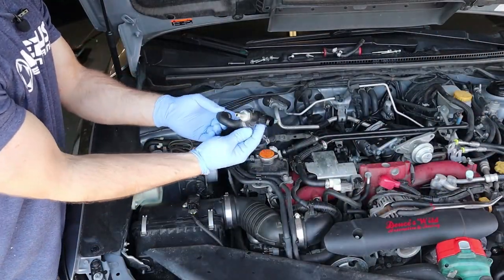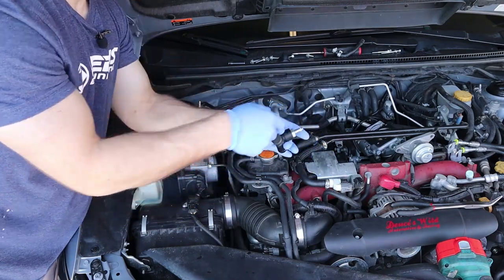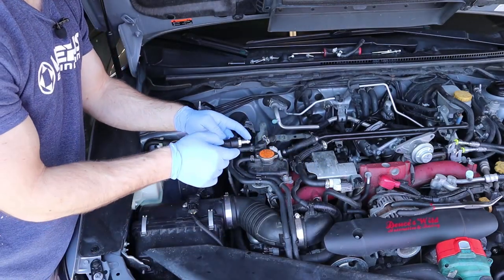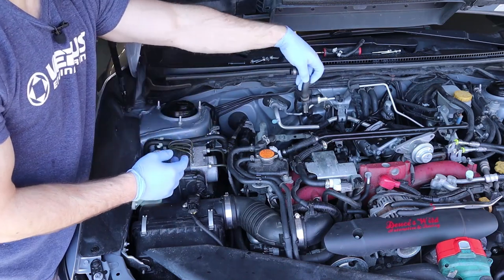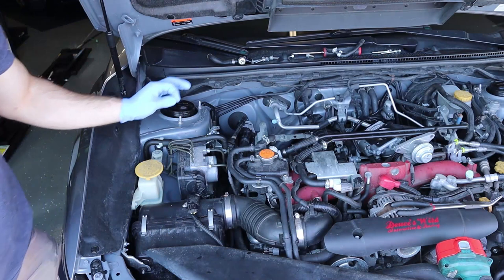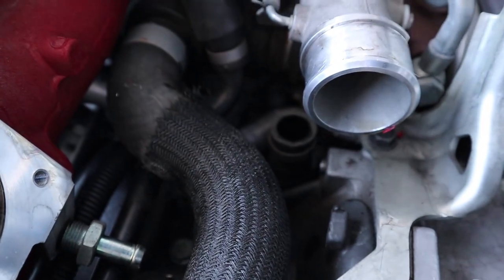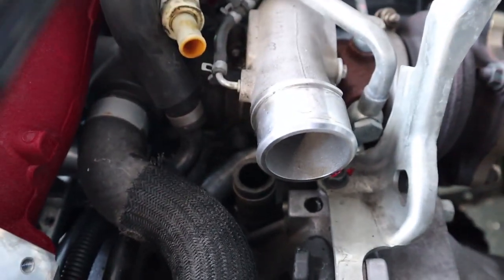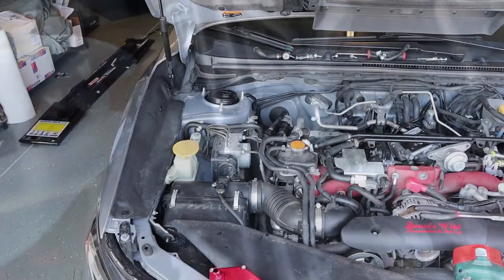Brandon was able to remove this piece — it goes to one of these guys down there, basically sitting like this in the car. This goes to the intake manifold; we're going to remove this and use it in our air oil separator. This came off the hose and that goes to the engine block. We can try to get a picture or video of that to help people. There's the factory unit, the three-eighths nipple, and the white fitting that also goes to the intake.